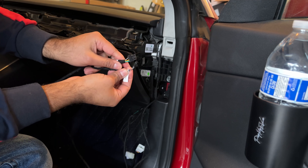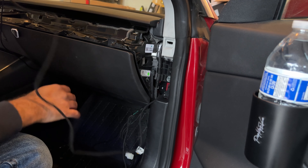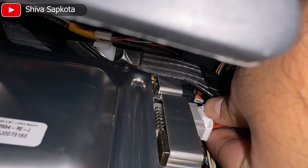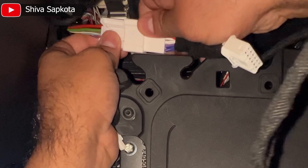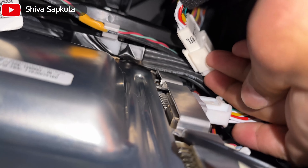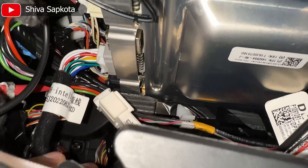This is the plug — the smallest plug, and there are two plugs connected to each other. This is the plug we're going to route from here towards the dash to the steering wheel. This is the difficult plug we need to remove for cars with the Intel chip. You just have to pinch on the middle tab and, while holding it down, pull the plug out. Then take the new harness and plug the male Tesla adapter into the female adapter of the new harness, then take the new male adapter and plug it into the Tesla computer. Make sure to align the plug straight to prevent bending Tesla pins — this is super tedious and requires patience. At the end it should make a complete circuit.